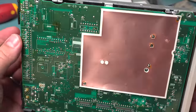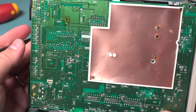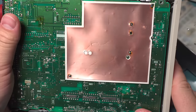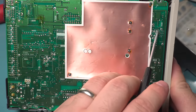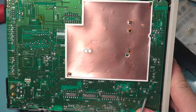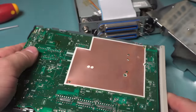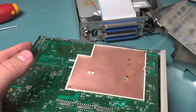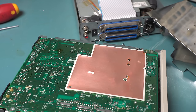This is where you'd be doing most of your testing if you're trying to repair one of these — and yes, you would actually repair things like this back in the day. There are a whole bunch of test pads and they're all labeled; even the trimmers are labeled, like this SD offset. It's a pretty standard CD-ROM drive from the time, but it just goes to show how things have changed. This thing is so complex and expensive to make compared to what we'd see now. I suspect the 600 model will be complex too, but not this crazy level.